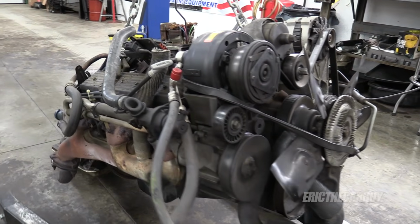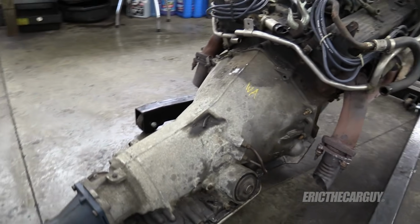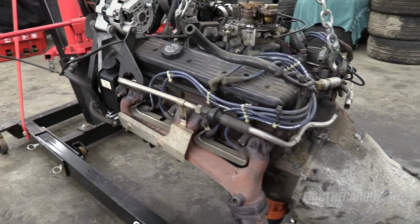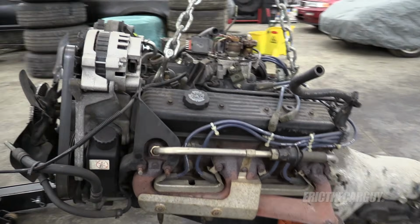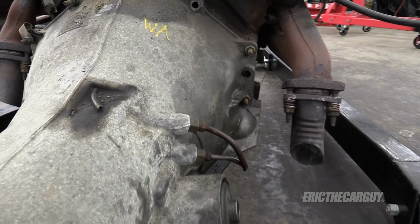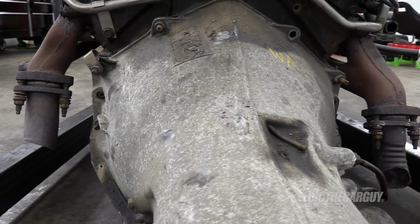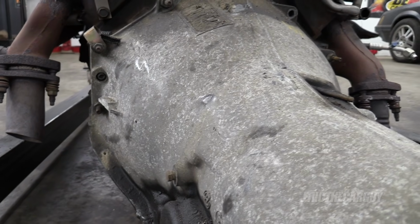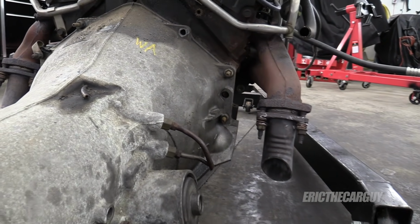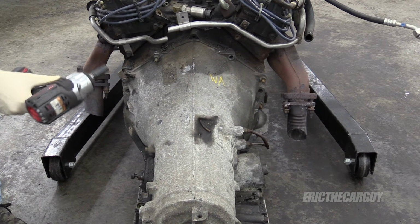Here's a look at the engine before disassembly with its transmission still attached. Something else I'm also not keeping. But this gives you an idea of what I'm starting with, which is virtually everything as it came out of the truck. For me, job one will be to remove the transmission. I have already disconnected the torque converter bolts while it was still in the truck. So this should just be a matter of unbolting the bell housing from the block. I'm not saving the transmission, but the fasteners fall into the category of things I'd like to save.